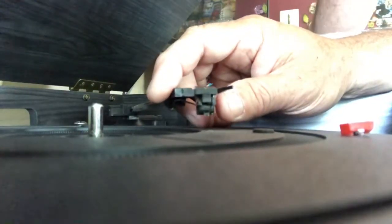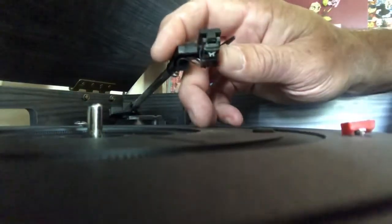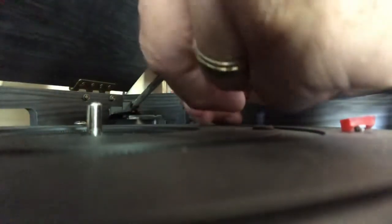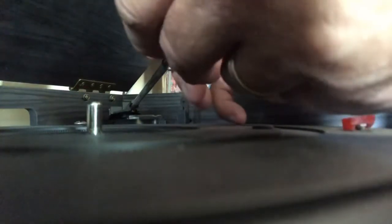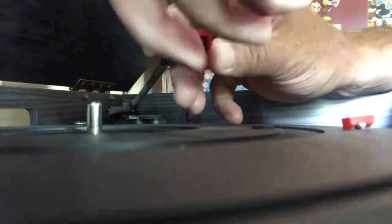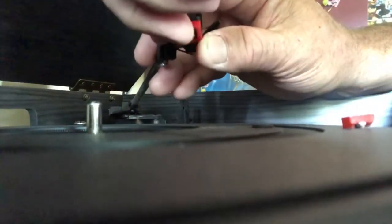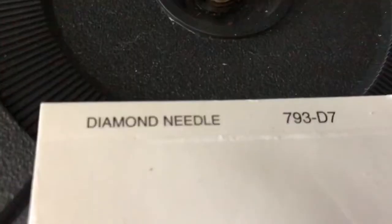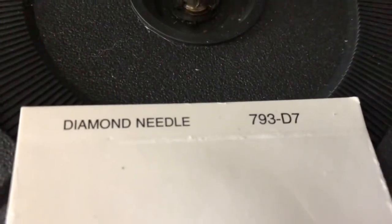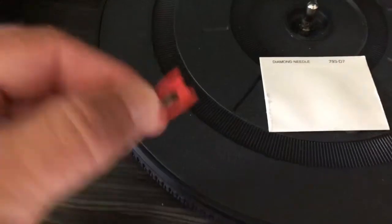And we're gonna pop in the diamond, and get some of the dust out of there. So again, it kind of hinges in the back. Touch it. There it goes. And then pop it into place. Look at that. Installed that easy. So if you want to buy one of these, I'll put a link in the description. For your reference, it's the Diamond Needle 793-D7. And that is how you upgrade from this crappy ceramic stylus to a diamond stylus on your all-in-one.